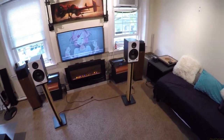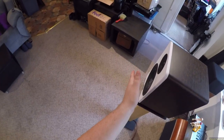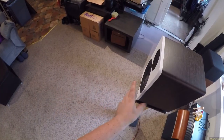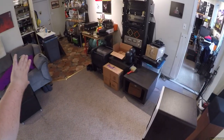I haven't had this in a while, where I usually review standing up, but then I actually sit down on the couch, and I stand up and I sit down, and I can hear the sound change at this weird angle. The timing between the two has to be right, or else the sound is weird. The treble is faster. It gets from here to there faster than the bass does. And if they don't time align at a good distance, then you end up having a good listening spot only up here. And that's what we have here.